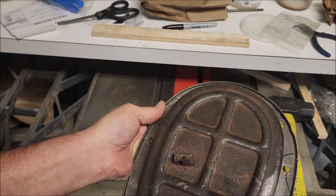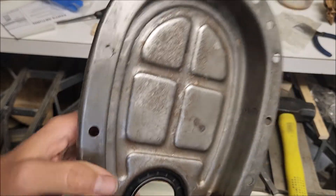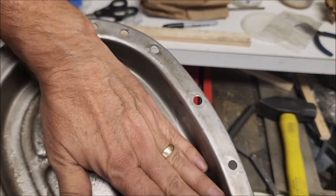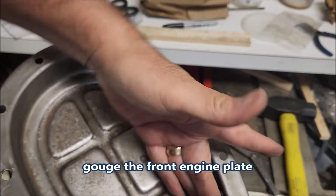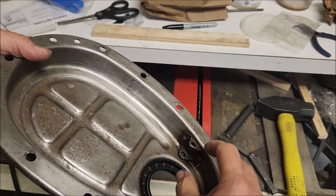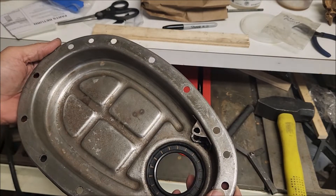That's how I straightened out the timing cover. I was very careful with the distance here — if your timing tensioner flops up and down too much, it can ride against the metal plate of the engine. You don't want that to happen. Some people put a washer in there to take up some of the slack — that's a consideration.